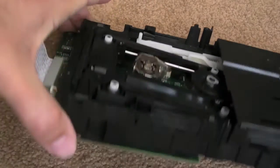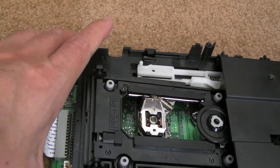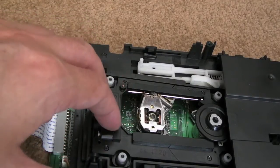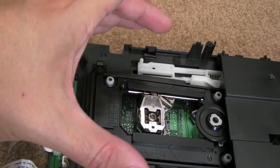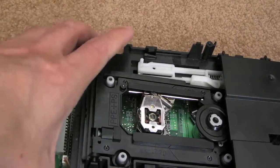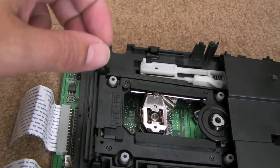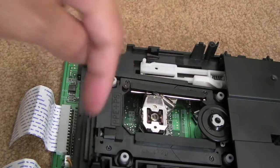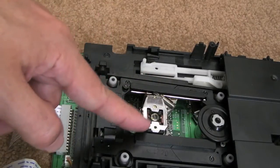One of the nice things with these 3DO drives is that, as far as I can tell, it's a bit like the later versions of the PS1 where all the focus control, tracking, focus gain, rotation and angle adjustments — the calibration of how the laser reads the disc — it's all automated. There are no pots on here whatsoever, which is nice. But still, it's been a bit of a pain to get this just right based on the spindle height and that screw. I did put some oil on the little bars — the worm bar on one side and the rail on the other — so that could have had a bearing.